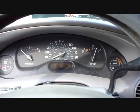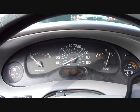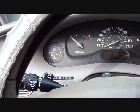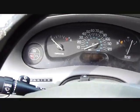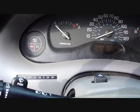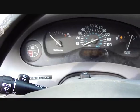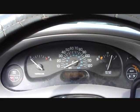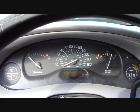The problem I was running into was the headlights just started randomly not working. I could sit there and push on the lever forward or sometimes turn the brakes on and it would turn the headlights on. But then all of a sudden it just stopped working. So that was a quick fix. It was only $70 from this place, 1aauto.com. Pretty cheap. So yeah, it's not bad. Don't have to take the steering wheel off. That's nice. It took me about 2 hours. That's the first time I've ever done it, so if you're thinking about doing it, it's not that bad.